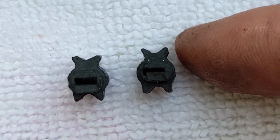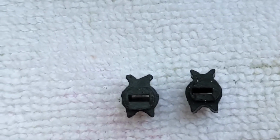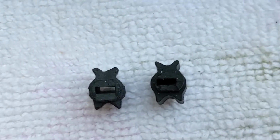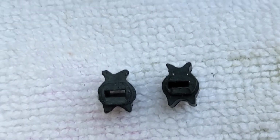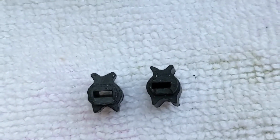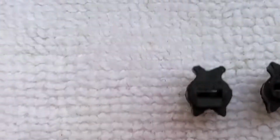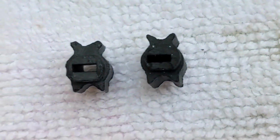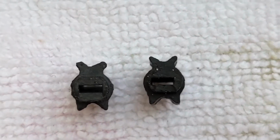Now, I mentioned lubricating them. Why, you might ask? These parts don't really rub against anything else. In this case, the lubrication is for preservation of the rubber. It's simply going to last longer if it is lubricated, and won't get all dried out and crack and leave little bits of black rubber like the old ones. Of course, those were almost 45 years old. They were probably lubricated too, but I'm going to lubricate these anyway because it will make them last longer.